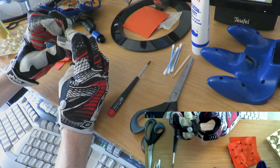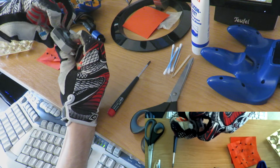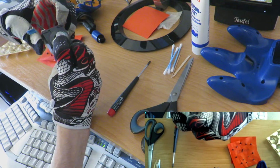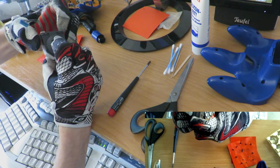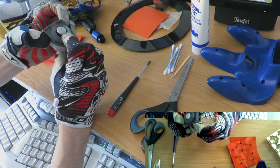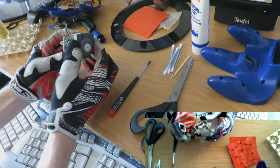Hold your finger here and carefully bend with your nails the plastic planks back till the case opens. But bend it slowly. You won't bend it a millimeter too far, otherwise you make the plastic breakable or even worse, crack. The less you bend it, the better it is.